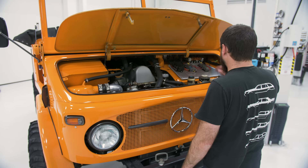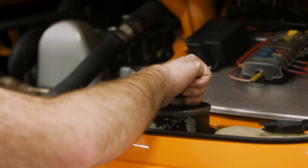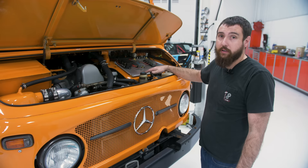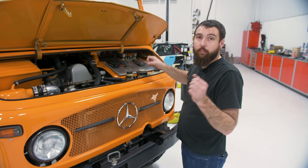I've got the power steering and power brake reservoir here because it is hydro boost. Hydro boost means the power steering pump provides pressure to a little cylinder — I used the cylinder off of an E28 M5 because a friend had a parts car, and used that reservoir to mount it. There's also a pretty good power steering cooler behind here, because with off-road stuff you end up sawing the wheel a bunch and overheating your fluid.